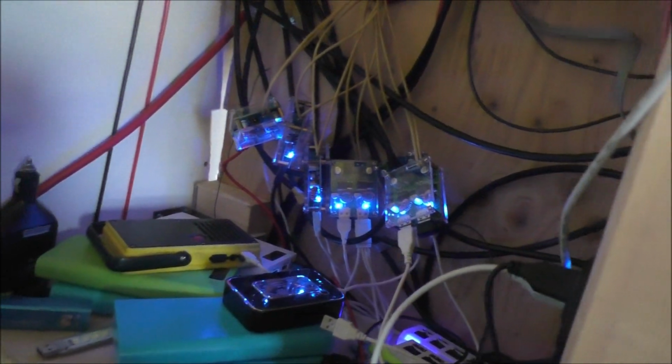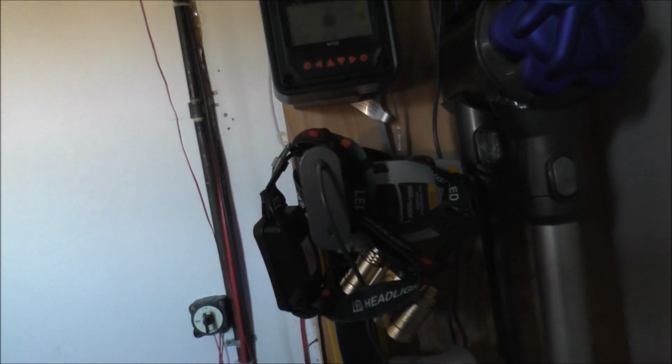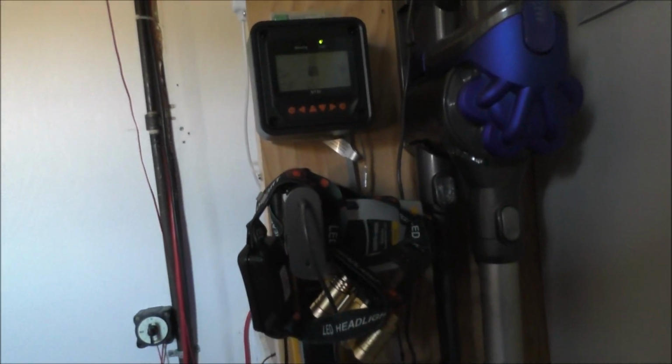The only thing with these electric USB heating mats, for them to work very properly, you need these high output USB ports. You got to kind of buy them specialty. Talk to Stu, High Tech Guy 18, for details on those. But so far, those little things are drawing 1.8 amps on the load side. As well, I'm charging a couple batteries, but that shouldn't affect anything too much. But we're gonna see how much heat's going on here.